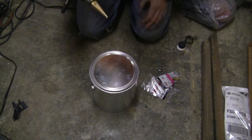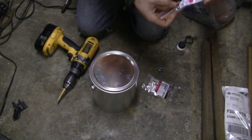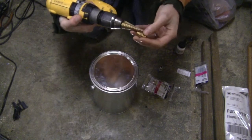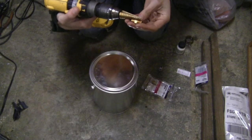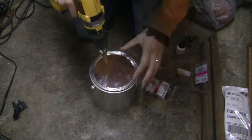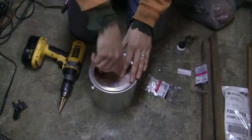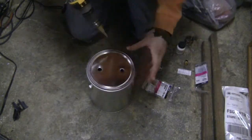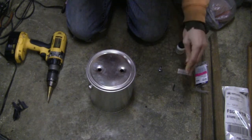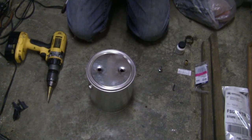Let's start by drilling a couple of holes the right size for male pipe thread. To find out what size that is, let's open up our bags and take a look — right about this step on the step drill. Let's drill a hole and test. After those are on there, we're going to put our fittings in, then solder them in place.